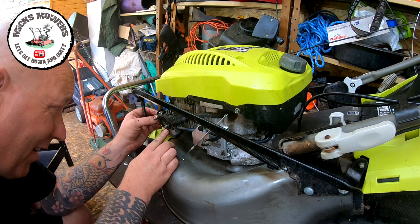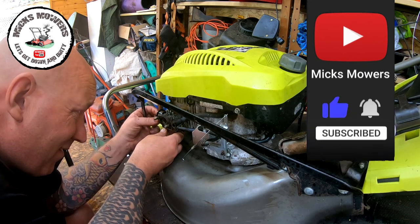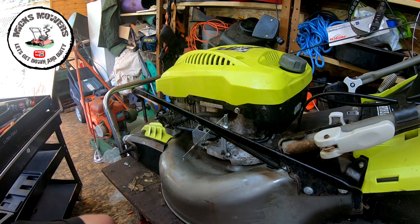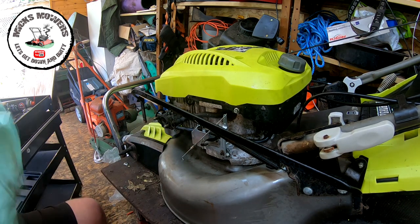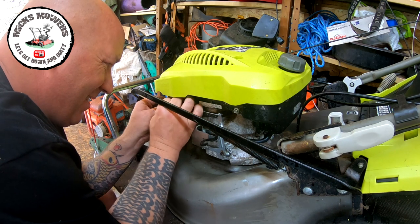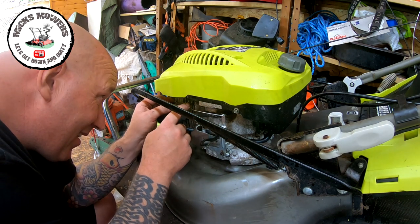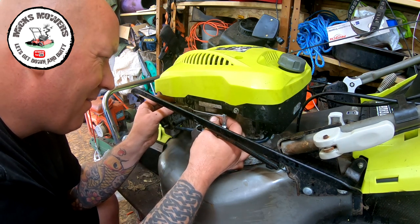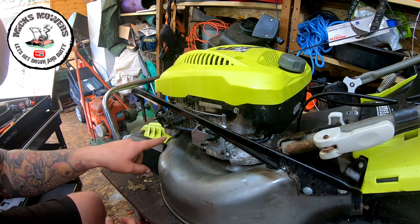So that's all on. I'm going to try and prime this carburetor. Take a little bit of pressure - try and get it to come out. Priming lovely - yeah that prime is beautiful. So with a bit of a rag, let's try under there and we'll see if I'm getting any leaks. This spring I'm not happy with but it'll have to do for now. That goes on there, and that goes in there - looks like that's been stretched to a degree, I might have to work on that or take one from a donor machine. It doesn't seem to want to flex a lot. We've got no fuel leaks coming out of the back of this here, so that tells me that's good.